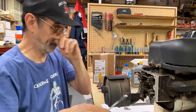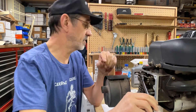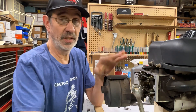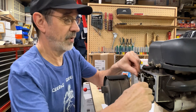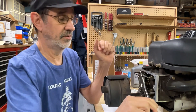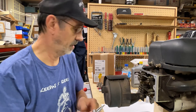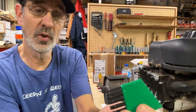Now you can use a 5/8 wrench, but with the slop in the wrench it's going to give you problems. I like to use a crescent wrench that I can tighten up tight so there's no play in it. I also like to use a set of these — they look like Allen wrenches but they're not, they're little Torx keys. You need a number 20.